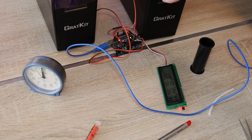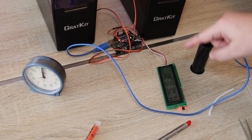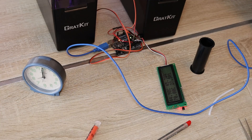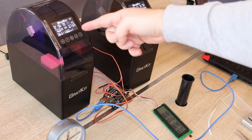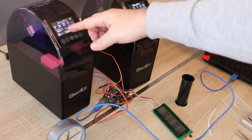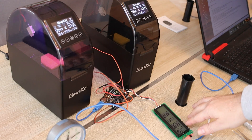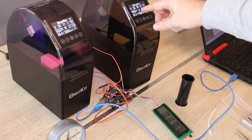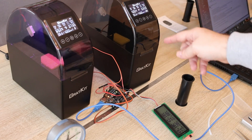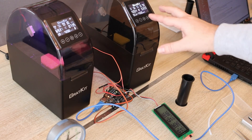After 15 minutes the temperature inside the new dryer is 70 degrees Celsius and inside the old one 45 degrees. Soon it will be time for the 30-minute measuring. I can see on the new dryer the temperature stabilizes around 70 degrees Celsius, which is the set temperature. According to my sensor, the temperature is 73-74 degrees Celsius, which is great. In the old dryer, according to its screen: 43 degrees Celsius, also set to 70, and the measured value is 49 degrees Celsius.